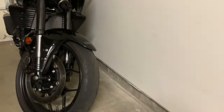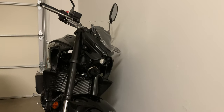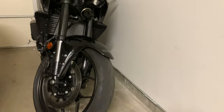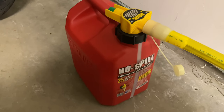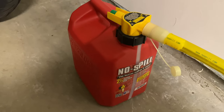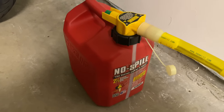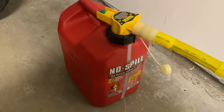Now this motorcycle — this Yamaha — is fuel injected, so that's not as much of a problem. But we don't ride it every day, so I put Stabil in this ethanol-free gas and that enhances its shelf life. I also cycle the gas through this can regularly. Now I'm going to show you how I use this gas can to add gas to this motorcycle.